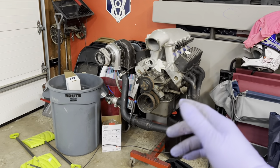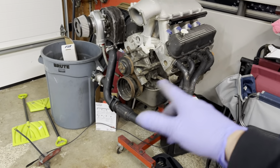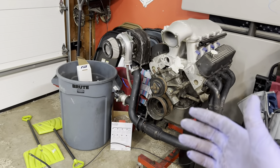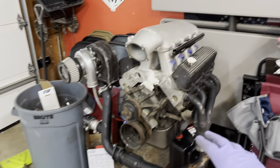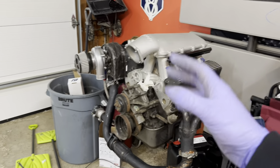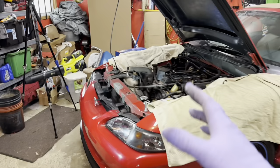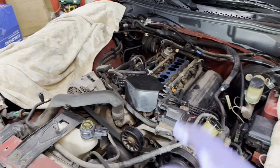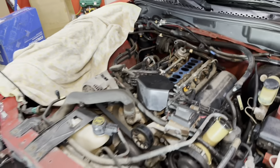This mock-up motor is actually an '87 to '93 Fox body short block with factory forged pistons. I originally bought it to use in my '65 Mustang. I know this engine runs great and doesn't burn oil, but I don't want to risk low oil pressure or other issues without fully rebuilding it. So I think I'll pull the heads, cam, and intake off of it to bolt onto the car's engine, and keep the short block to build up properly with aftermarket forged parts later.